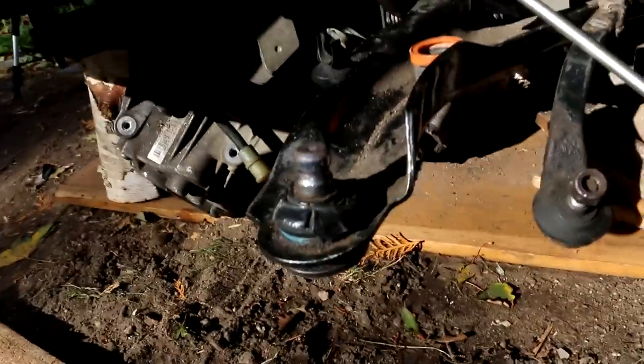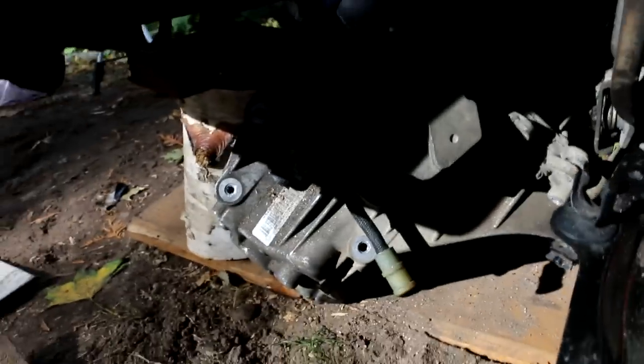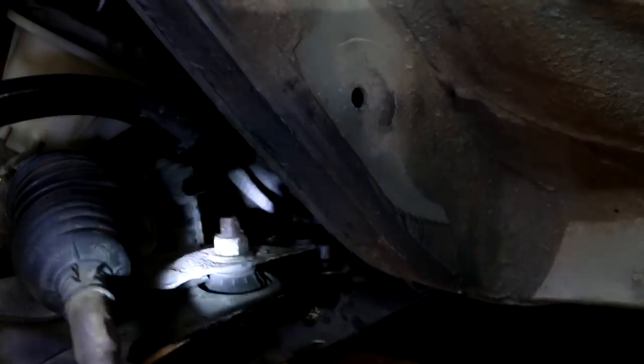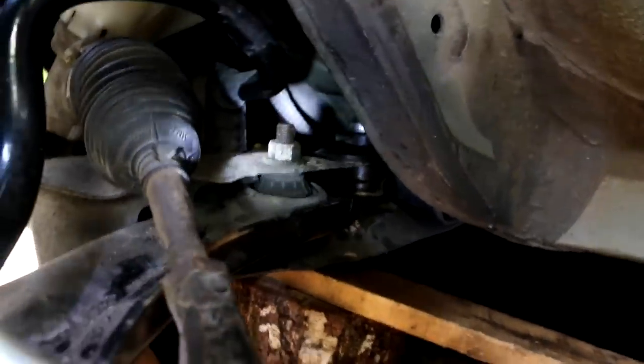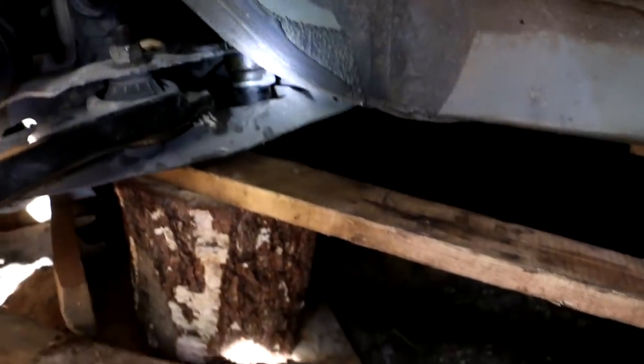Got to remove all this tire support, plus you need to take up the subframe. It's in two parts, so the first part is easy to remove, but you have to put this radiator on some sort of support, and then of course, you already seen on video, but anyway, and then I had to remove this one, plus to remove the subframe from the main frame, I kind of had to put some sort of force there. I use a crowbar and just one side, other side, until it get loosened, but I kind of didn't remove the steering gear, plus right now it's not completely holding on the steering gear, but it's kind of holding on this wooden brick, so it's not in any way breaking this, plus this came out easy.